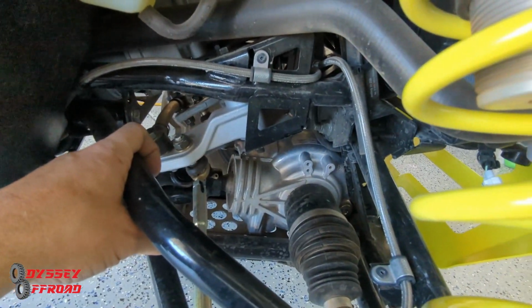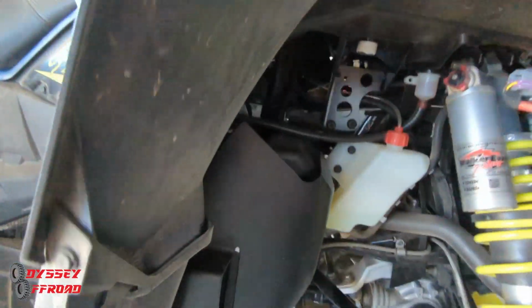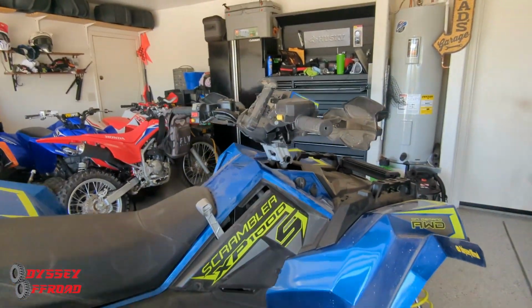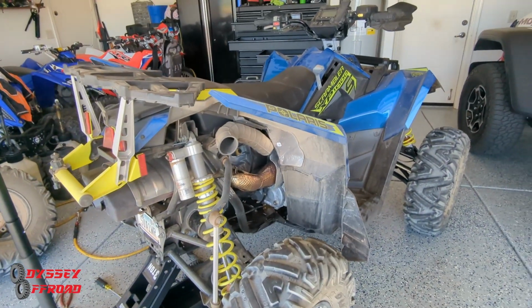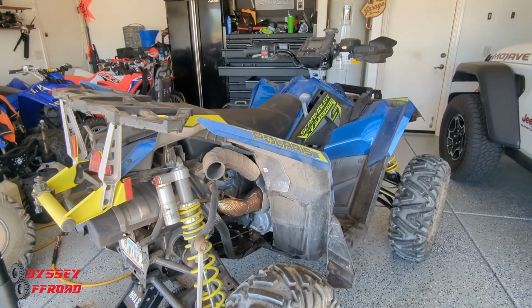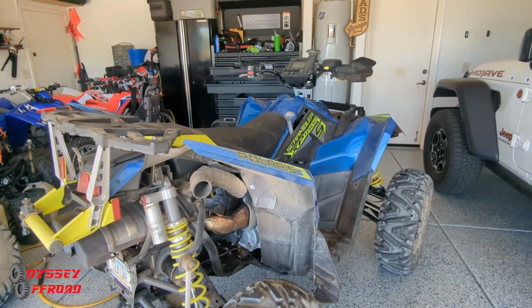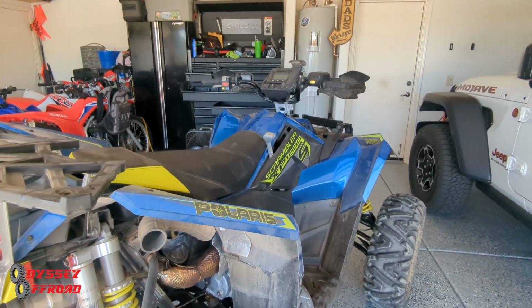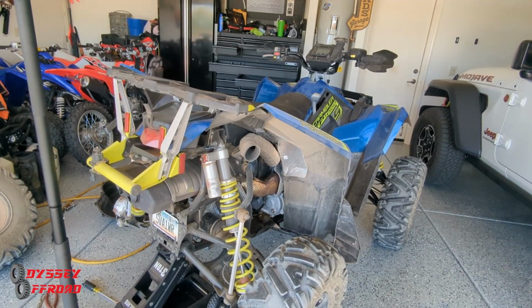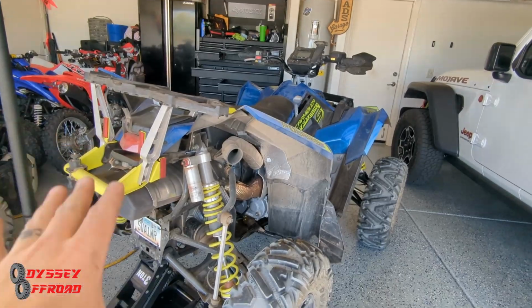But the steering stem bushing, you can actually probably see it from here, maybe. And that's a nice big thick billet piece. Really secures the bars good. The stock one is basically a piece of plastic and a metal clamp around it, and it's not greasable. Can't get any grease in there. So this one is great. Big thick billet unit. Tightened up the steering stem. No problems now with that. That's nice and tight. And we just got to do the drag link next because there is a little bit of noise coming from down that area. But right now we're just working on the belt maintenance.